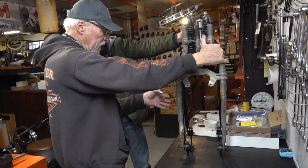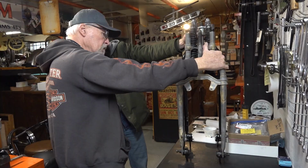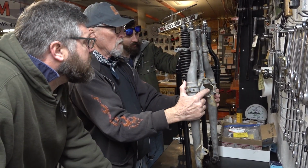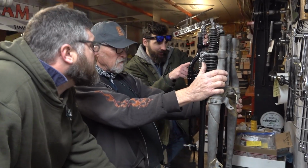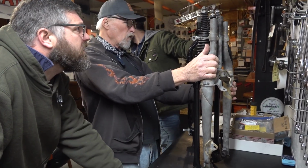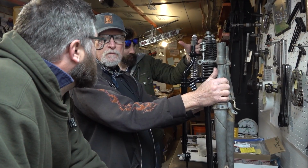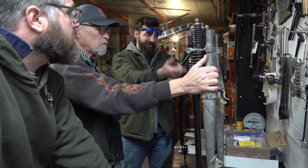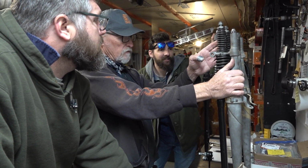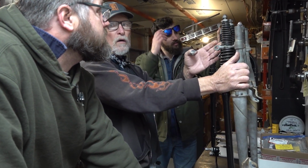And this is European, not OEM, so it's not going to be exactly the same. I'm wondering if I might have these springs not correct either, the inner springs. Those are just floating in there. They're more of a rebound spring. Actually, I've never even run those in my race bikes. Why are ours all taut like that? It's the way it came, right? Those inners came with it. You didn't add these, did you? I didn't add them. It all came as a kit.